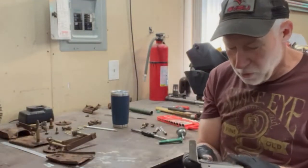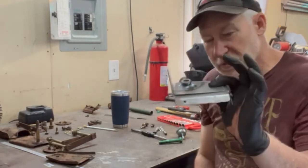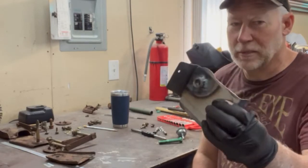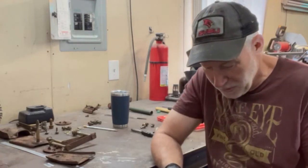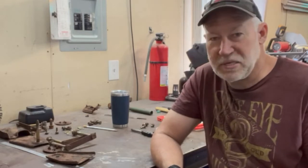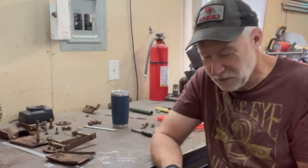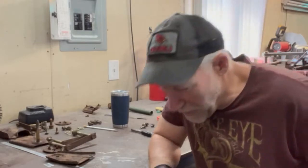Got the tapping plate all welded up — came out just fine. Got my patch panel with the slot cut out. The tapping plate goes in there and I've got some movement, giving me a little wiggle room when I go to mount the t-bar crossmember back. I'm going to screw it all back in, fit the t-bar back up, and make sure the holes all line up before I weld it in. I'd like to weld it in without the t-bar in place because the t-bar is a pain to put in, but it's better than cutting it out and starting over because the holes have to be in the right location before it's welded in the car.